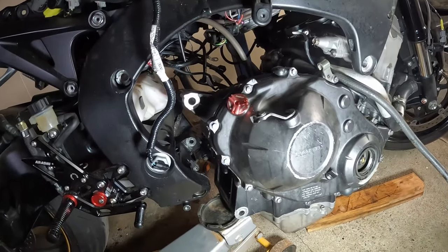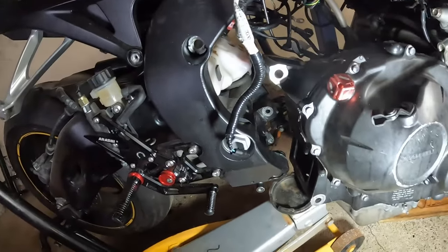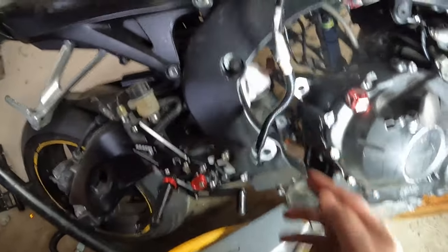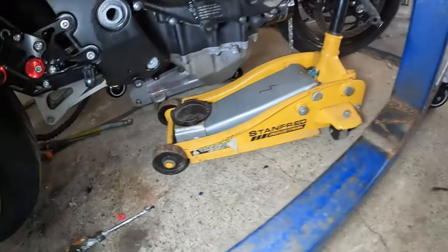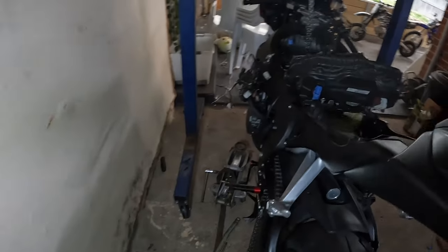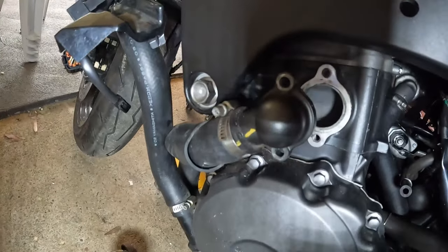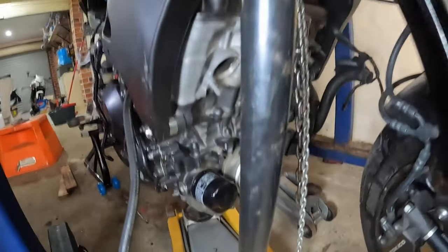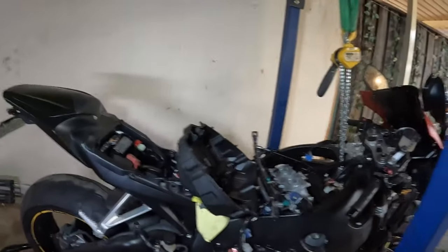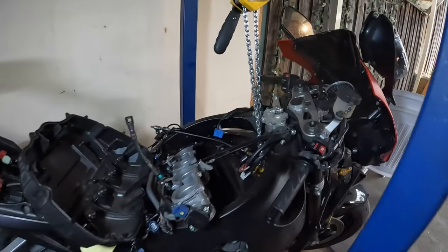After a lot of screwing around and putting it in the wrong way, I realized it should be up this way. We bring the engine tilted like this, the way it is, and aim for it to come up through this part — so it's got to come sort of a bit forward and then push backwards while this is up. After putting this bolt in and removing the water fitting on this side, I hoisted the engine up and got the two hanger bolts in on both sides. This is a big milestone — everything is loosely in for now. The main bolts and the bottom one are all loose to begin with.